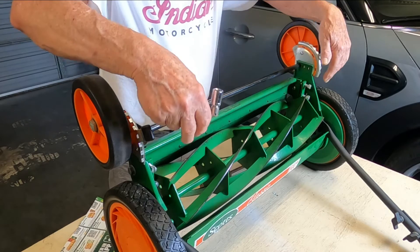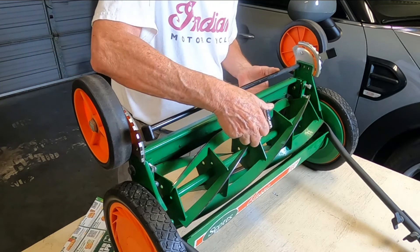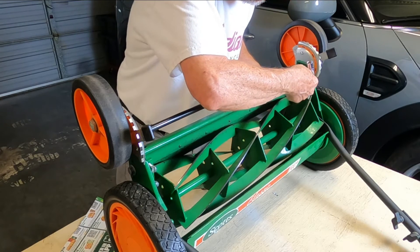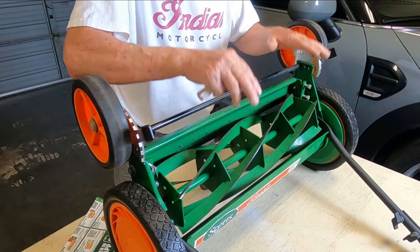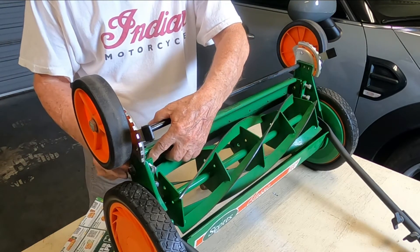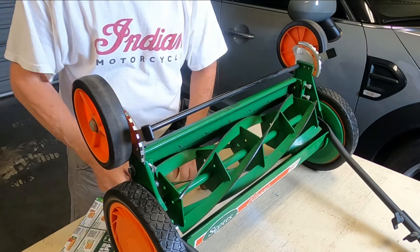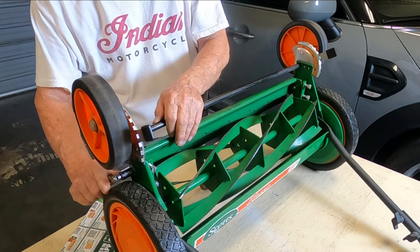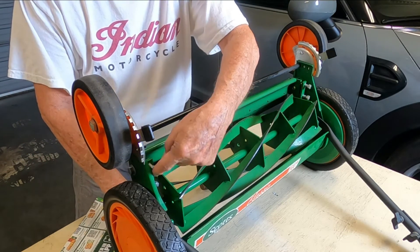What we're going to do is bring this blade down until it's getting closer to making contact with the cutting blade — the cutting bar. This is adjusting the cutting bar up and down. Since ours is loose, we want the cutting bar to go up closer to the blades — it's too far away. It pivots right here, and on this side you can see there's a bolt right here. If you find these are too hard to turn, you may have to loosen that bolt — it's a half inch — just a slight little bit of loosening so that you can turn these with enough ease.